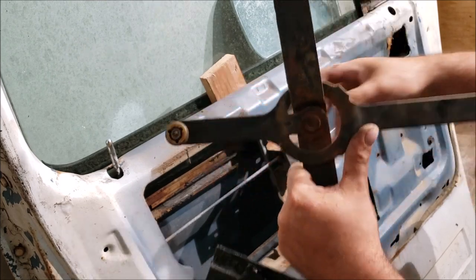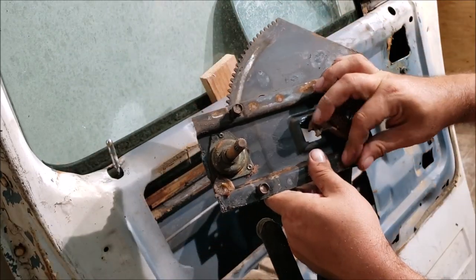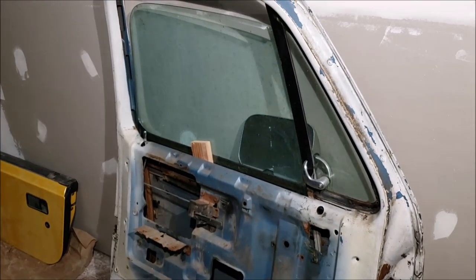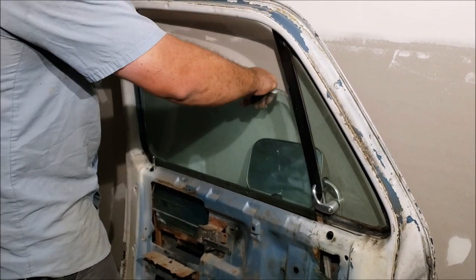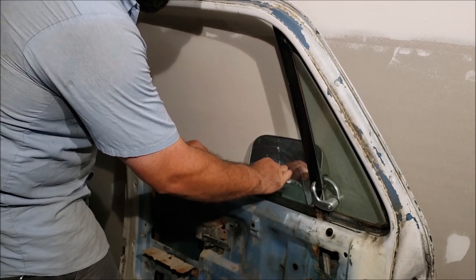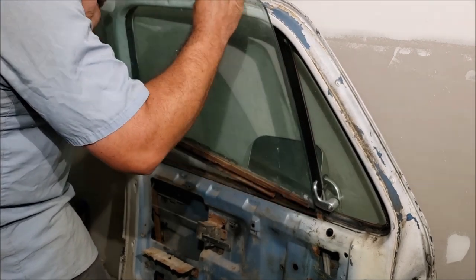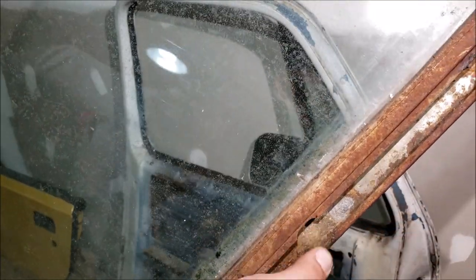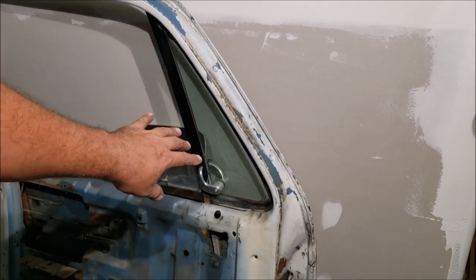It's not that bad, it's still good. Always try to put your bolts back where they go as quick as possible. With the window regulator completely removed, we can get that glass out from the inside. I kind of slide it out of the track - it took about 10 seconds to get this out. That was the cutout I was talking about to get that regulator wheel out of the door.